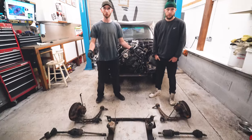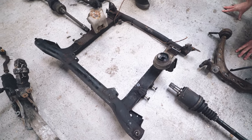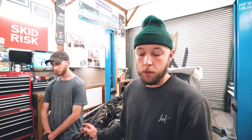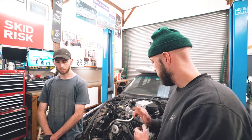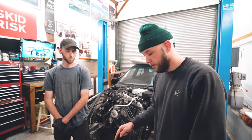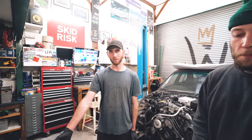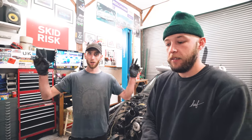Check it out — IX business subframe, arms, and steering rack from a 525iX E34. It has a different subframe layout which will hopefully give us more room. Today we are going to take the old one out, take this off, and put this on. It's a steering rack setup as opposed to a linkage, and it will give us more clearance on the sump. Hopefully — we'll see. Probably going to have to chop something.